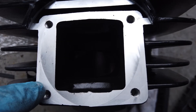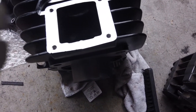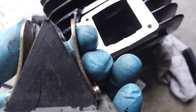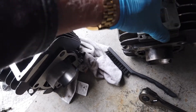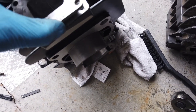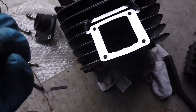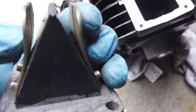So that's it for today, folks. Just waiting on the exhaust valve and the needle bearings so I can get this thing rebuilt. Obviously first I have to get this reed valve sorted. These reed plates might be bent up too much — I'll have to read the manual. It could be they just need to be bent a little bit, but they fit in the cage fine. I'll go and double check in the manual what distance these plates should be, and I might be able to adjust it.